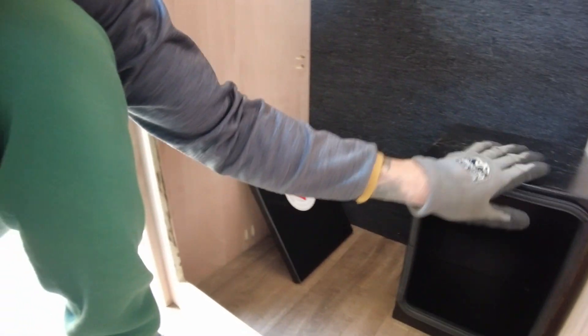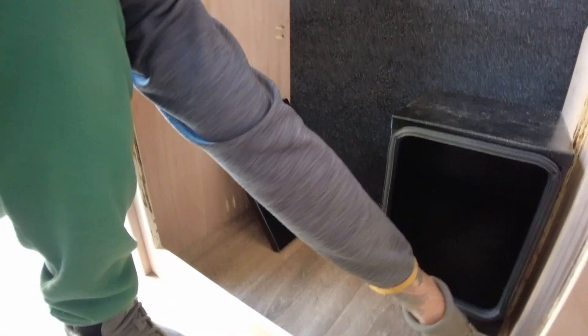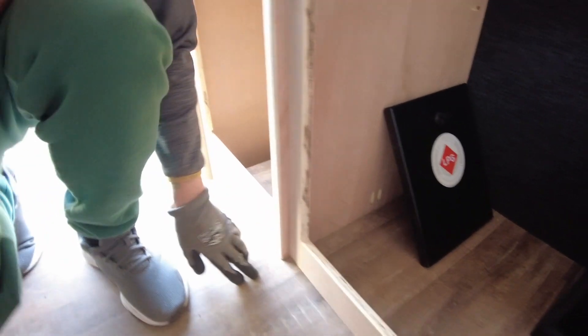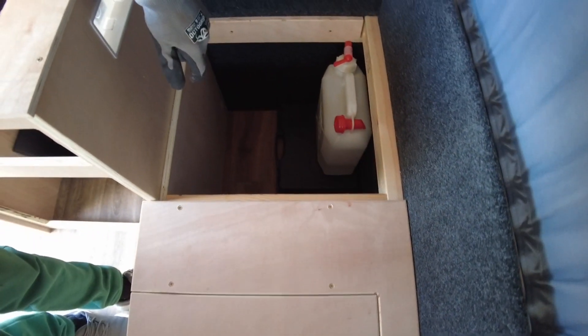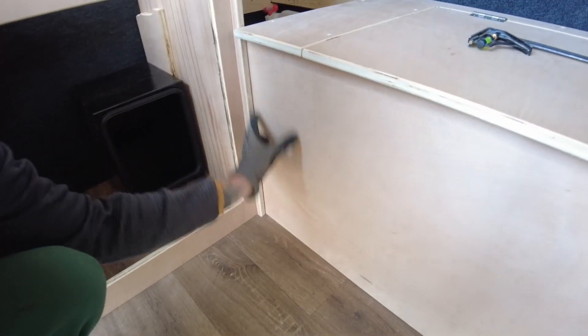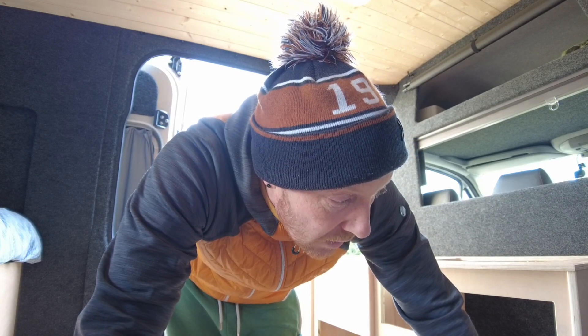I'm going to re-measure it. We're going to do that there. This is then going to be raised, so the dropout vent is going to be quite a long one. We're going to raise this off the floor so we can actually run water pipes through there so you don't see them on this side. We're just going to have a false floor and we can run everything underneath — I don't want to be seeing anything, just looks cosmetically better. The diesel heater will be going in this area. This is where the hot water tank, diesel heater, diverter, heat exchanger and everything's going to go. The diesel heater will be coming out in this section here — that's the bit I've had to extend really because of that delay on the hot water system. So I'm going to check out and see where we can put this diesel heater first, and then I'm just going to take a stab at fitting it.